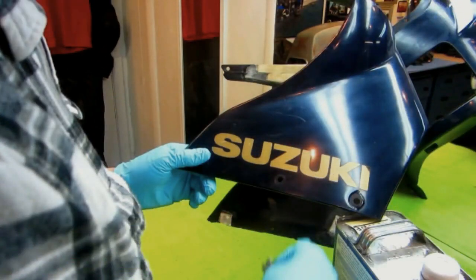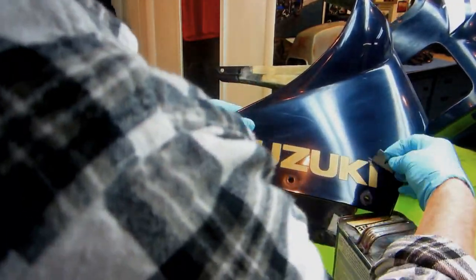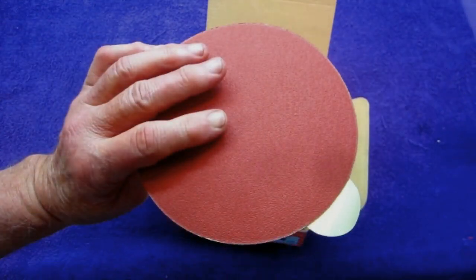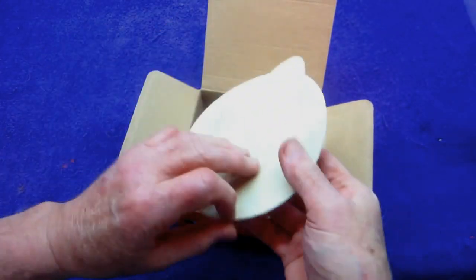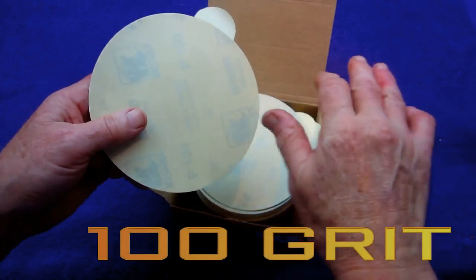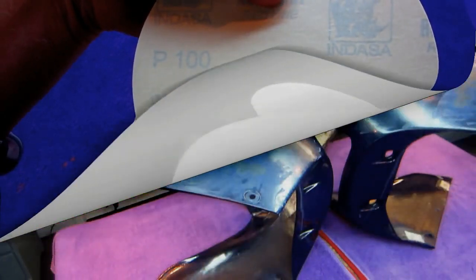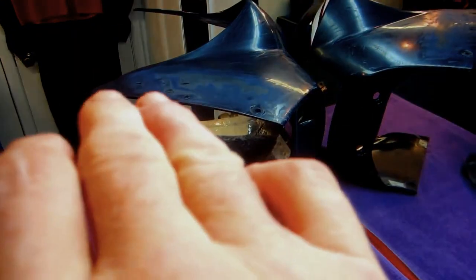We caught another relatively small but important lucky break — usually some of the lettering or trim is actually under the clear, which really adds to the job. Being able to get the stickers off with a heat gun was another break. I was going to go right down to primer and wanted the paint to get an absolutely perfect bond. We have a brand new box of 100 grit — the best for removing material in a hurry with an orbital sander. This will make the job go very quickly. I didn't want to paint over a 30-year-old paint job, so scuffing this part with a power sander made it a relatively straightforward job.